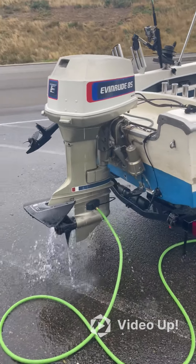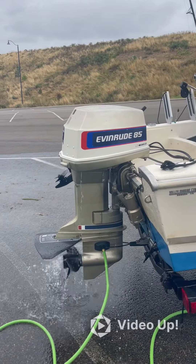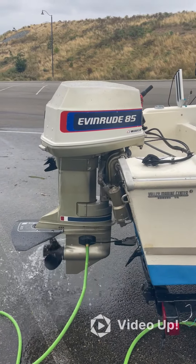The key is to let this flush for at least five minutes. If the motor's warm, five minutes is sufficient. If the motor's cold after you got home, I would suggest running it for at least 10 minutes. When you're done, just rinse the outside of the motor again and you're done.